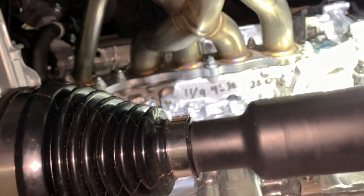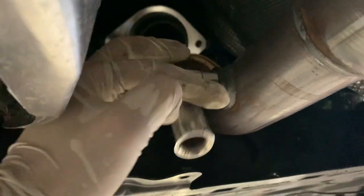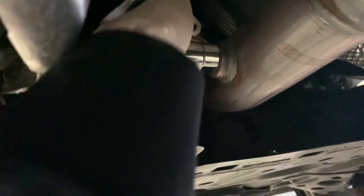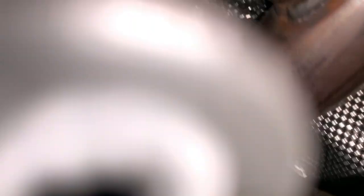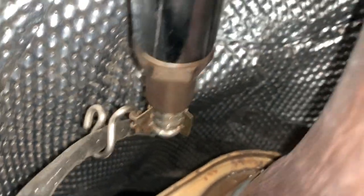This is how the header should look once you tighten all seven nuts. Before you install the mid-pipe, you gotta make sure to install that defouler where the O2 sensor originally goes — that will avoid getting a check engine light. It's pretty easy; just a quick demonstration. Just make sure that the wires are pretty loose and not tight — you do not want to rip this wire.